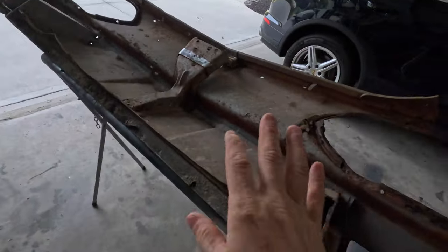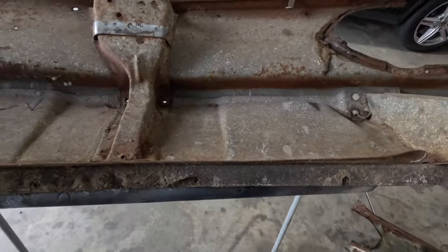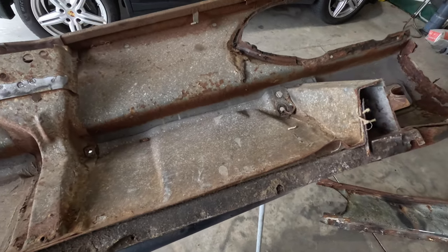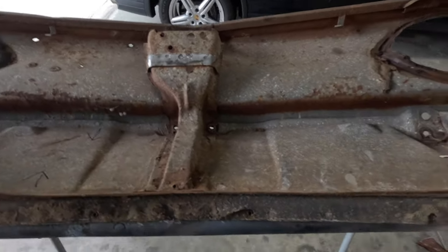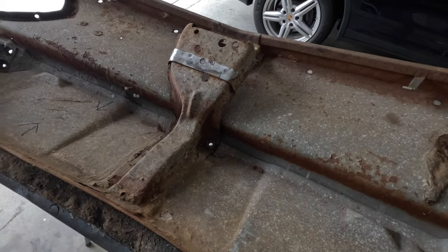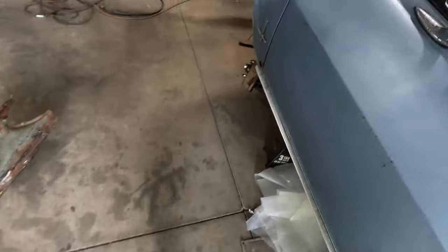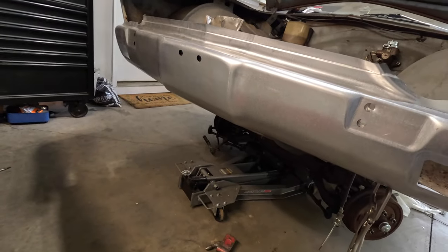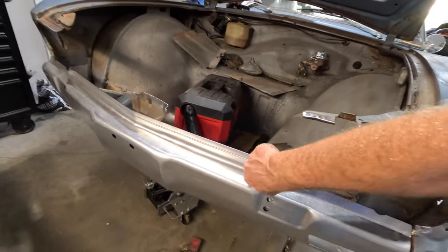Now that I've got the original nose cut off, it's time to start working on the new front piece. Coming over to the little stand here, we've got a lot of work to do because this still has some rust — it's not perfect. The first thing to do is cut out all of the original support structure. On the old nose we cut off the skin, leaving the support structure in place. On this piece we're going to do the opposite — cut out the structure and leave the skin in place. This is going to be a tricky operation. Worst case, I do have another lower piece that I got brand new from Clark's, so we've got options either way.